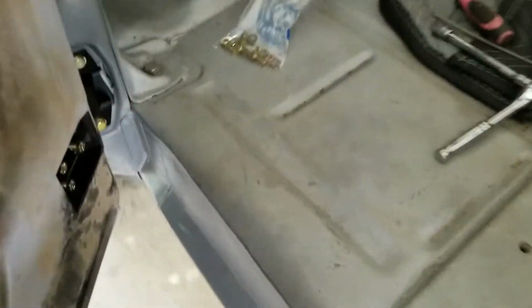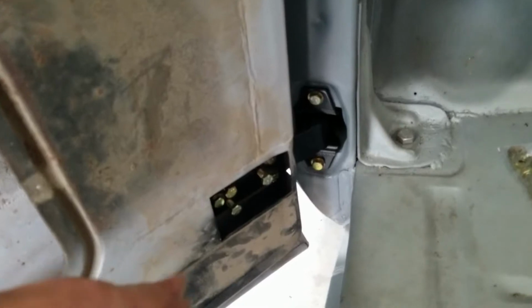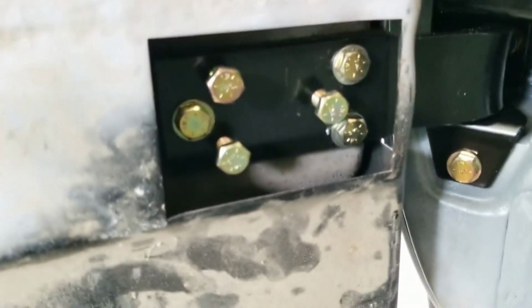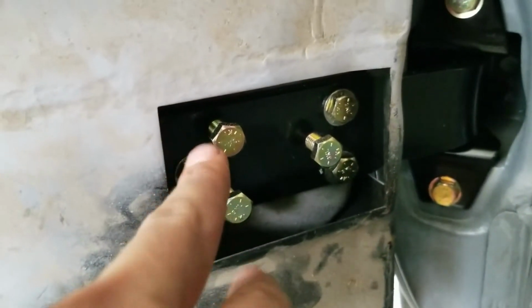The front door is on, but I can't get it aligned right now. It won't shut all the way because it's hitting the floor right in this area, on this ledge, and I can't push it away from the door, or away from the cab yet on the hinge adjusters, because I got the same length bolts for everything, but what I didn't think about was if you were to max out the adjustment of these, the bolts are no longer long enough to reach through and grab.